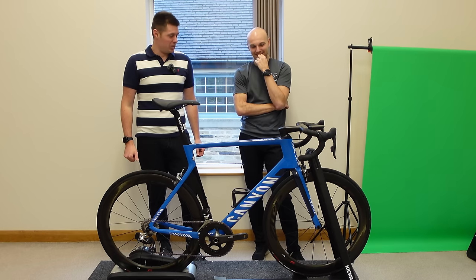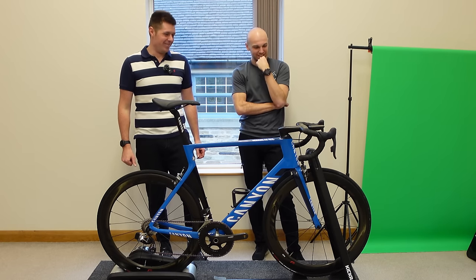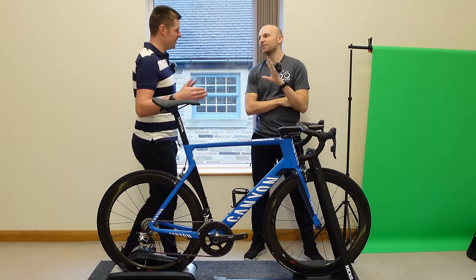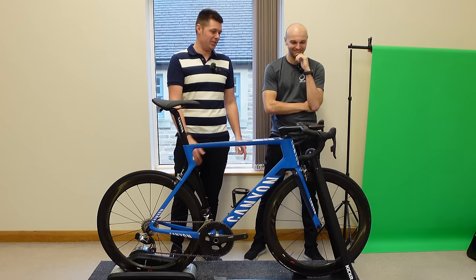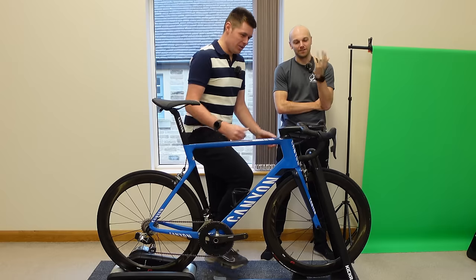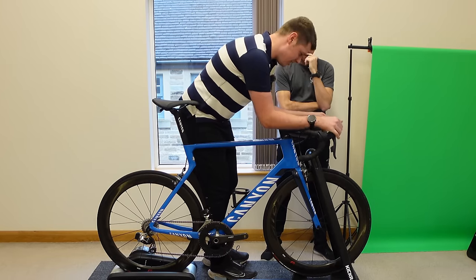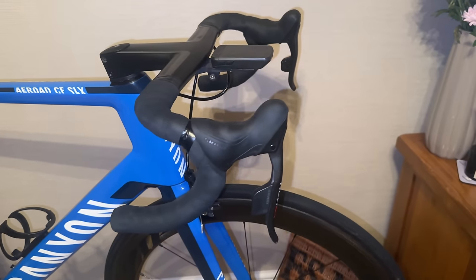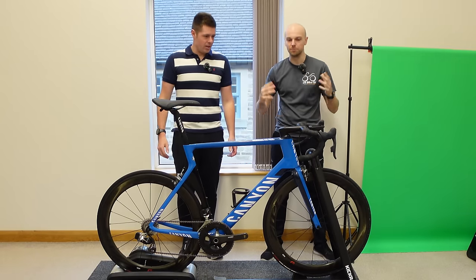Now first thing — Dan, you absolutely love the colour, so let's lean into that. Where shall we start? Let's start up at the front, that's the most obvious. Your shifter position leaves a lot to be desired. We should also say I've not fitted this bike at all. I sometimes jokingly tell people when I point out tilted shifters, 'Oh Dan fitted me and he told me to stop doing that.' So what's wrong with it? The angle of the shifters is pointing in, and the shifters are really low so they drop down off the bar quite a lot.